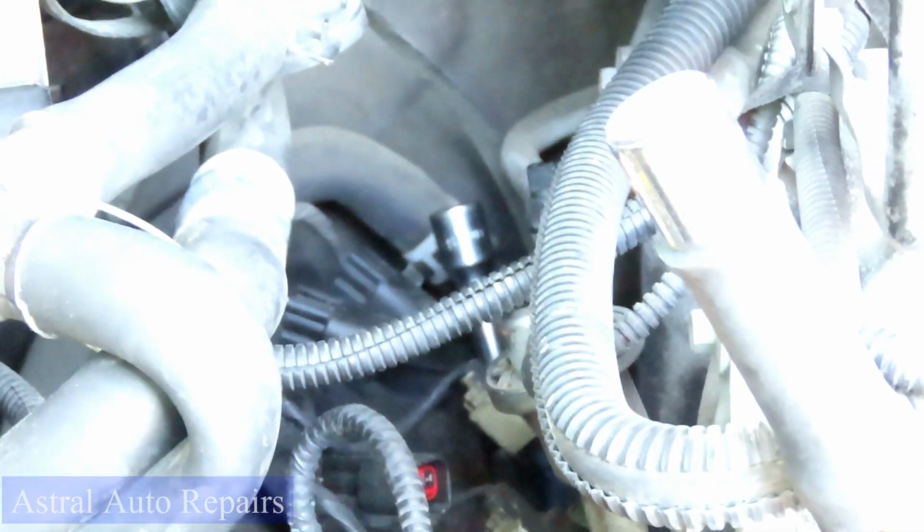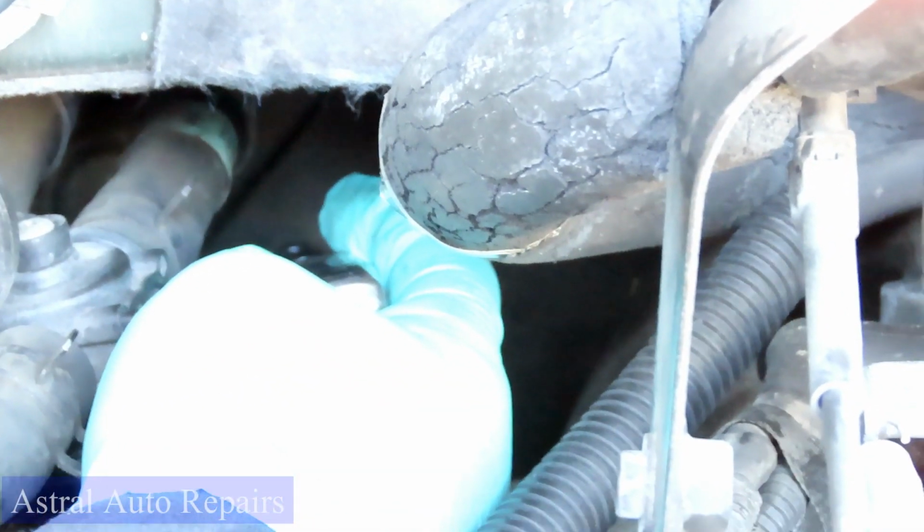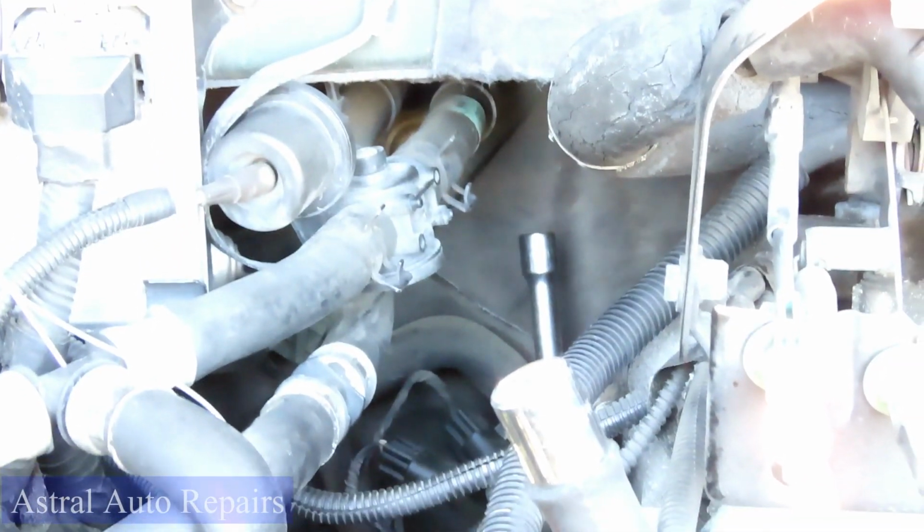Now, if you're using just a regular ratchet, it would suck. At this point, we just use that 6-inch extension back there with our ratchet. But if you're just using a regular ratchet, you're definitely going to add that 4-inch extension in there. Then you're going to want to reach in there with your 3/8 drive ratchet and slowly tighten this up. This thing definitely would take a long time to do. If you're sitting there with a regular ratchet, you've got no business following this video.